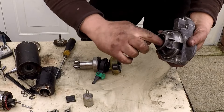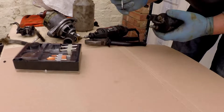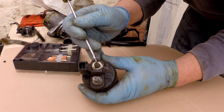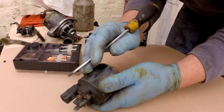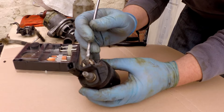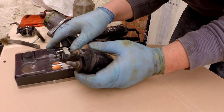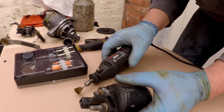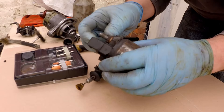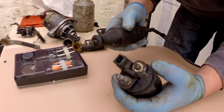Put a little bit of grease round there - don't want too much. As you can see, that's where the corrosion has built up and that is most likely what's caused the starting issues, because there's a voltage drop between where the battery is and where the cable goes on. That's the output from the switch side that feeds the motor windings. So that's a good possibility. I'm going to clean that up - I've got a cheap little Dremel kit to clean it, because I don't have access to strip the solenoid down much further. There's probably corrosion in there but I'll take this off and see what I can do.